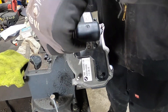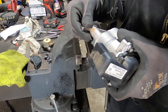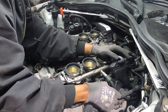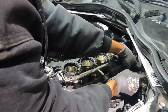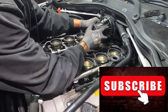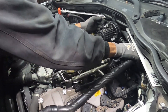These two blade-looking things sticking up are the connection points for the cover - they fit into two slots in that cover. After doing all this it's time to put it all back together. I had removed the harness for the injectors when I was taking it apart but you don't have to go that deep. The injector harness on this side you don't have to disturb. To get to the harness I had to remove this breather cover and also the secondary air pump because the harness was so rigid and in the way - I didn't want to stress that flexible plastic.